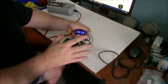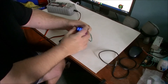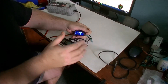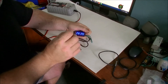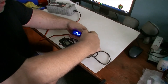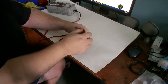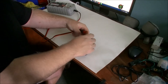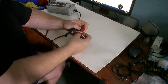With electronics, please understand that when you're using cheaper resistors and capacitors and diodes — all the stuff that goes on the circuit board — a resistor might say 100 ohms but it's not exact. Each resistor, even though they're both nominally 100 ohms, will be a little off. When you add all these components together and they're off by the smallest amount, your end result is two meters side by side that won't read the same thing. Don't worry about it too much — you're using this for car voltage.